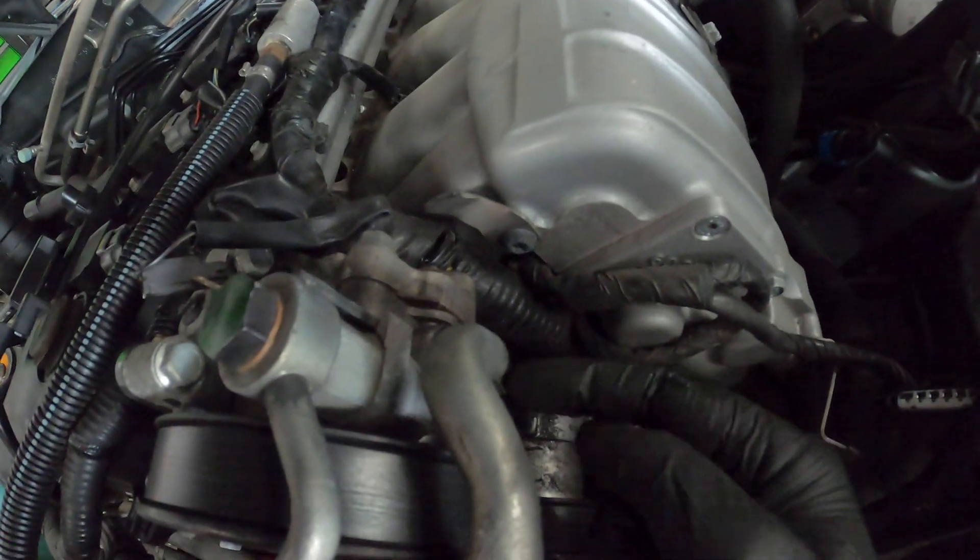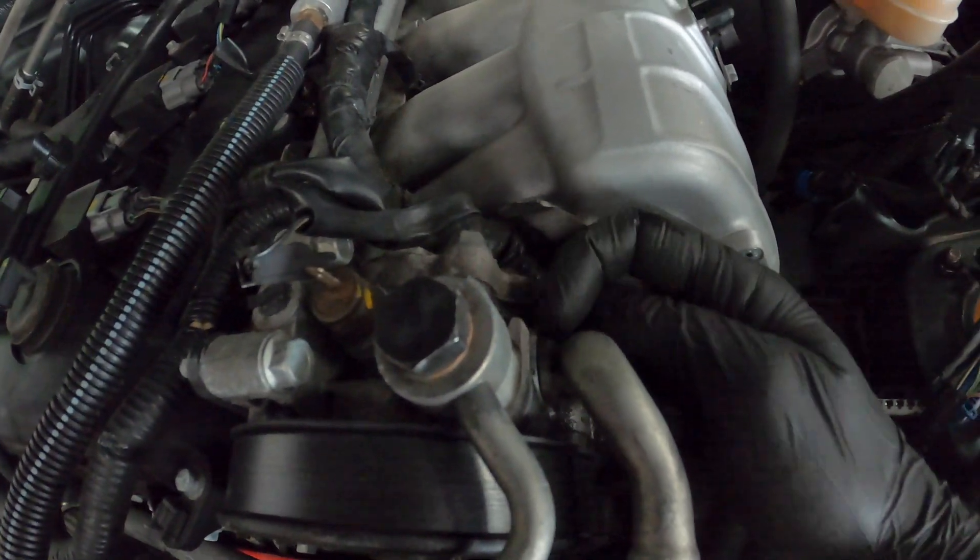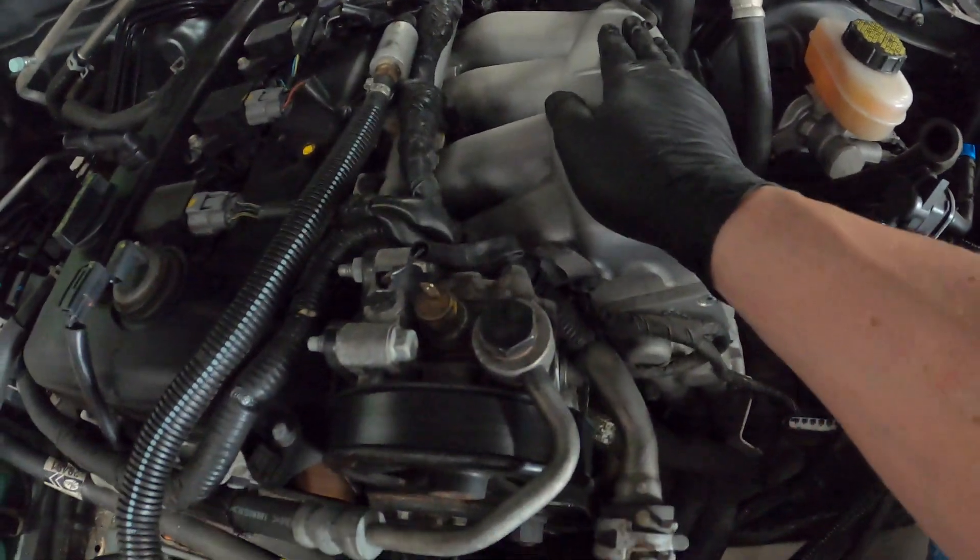Also taking note here that the power steering has that classic crack in the surface — crack as in it's not sealed because someone bent it. So when you move this around, if you bend it wrong, it's only secured by the one bolt at the bottom. So this is open at the top. He was probably sucking in air — power steering is probably groaning.